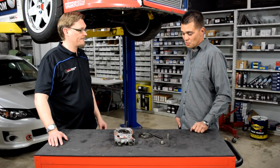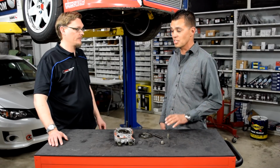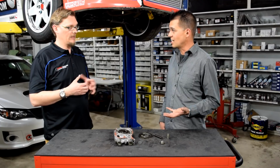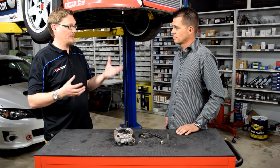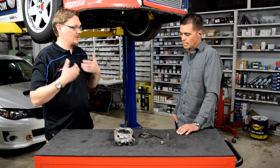Exactly. So this kind of led into, well, I really want to understand. I think I have a volume problem, of course, and I do. I increased the tolerances of the engine, so the flow through the components has changed. You've got less restriction, less resistance. You've got basically a larger straw throughout the engine that the oil is trying to fill. So we increase the maximum pressure, but the 10 millimeter pump can only feed so much oil.